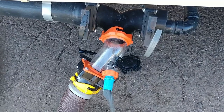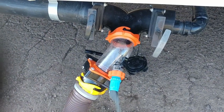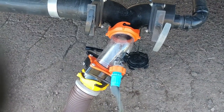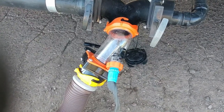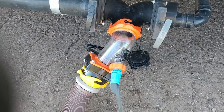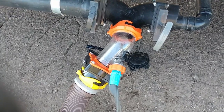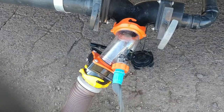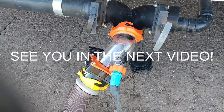The gray tank is still draining, but look — it's draining nice and strong, and before it didn't do that. One of the things when you add this vent mod is that when you first open it up it gurgles, so you can tell it's venting correctly. It's a whole different way of working — just adding that simple pipe makes a lot of difference. Very good addition to our 2019 Casita. See you in the next video.